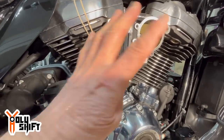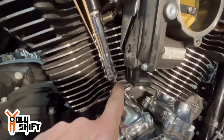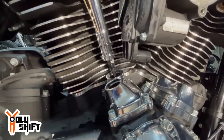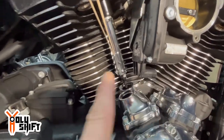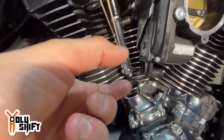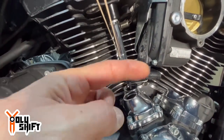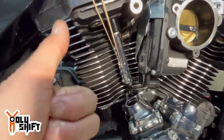The way you know how much bigger to make it, you need four full rotations of one surface. The way to do it is to mark it with some kind of white out marker, and then count four rotations where you're extending the bolt. It's a long bolt, it's a push rod. Once you're at the right place, you take the locking nut and tighten it against the other. That's how I know how to get the right length, and then you go to the rest of the three. Hope that was clear enough, and if not, I did my best, sorry.